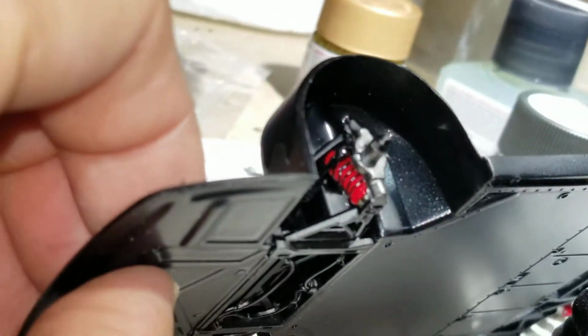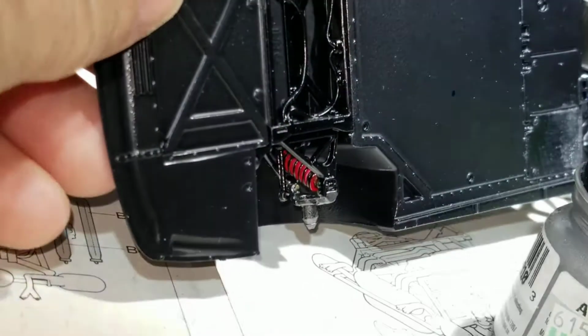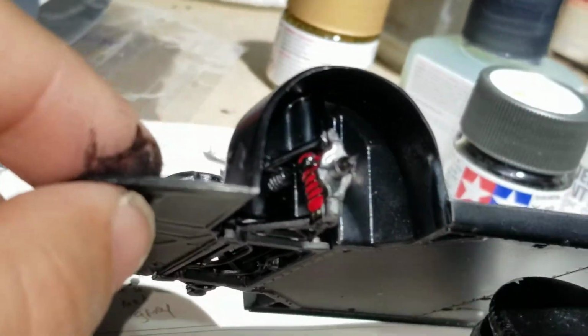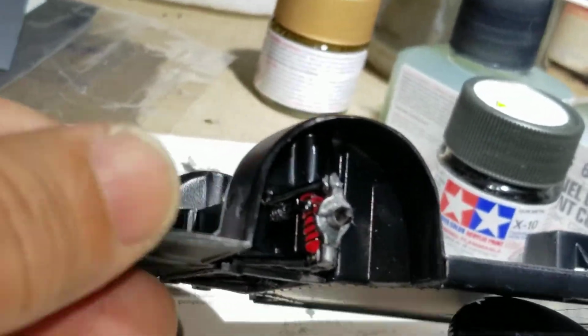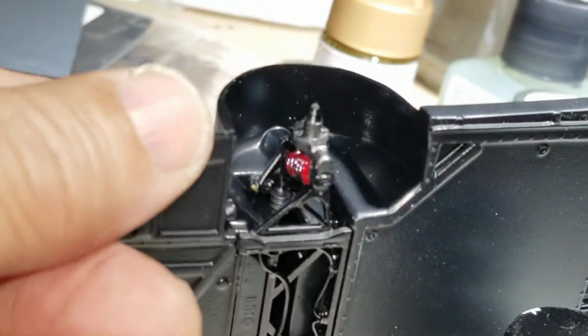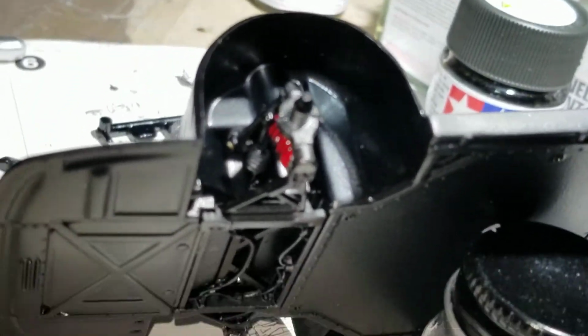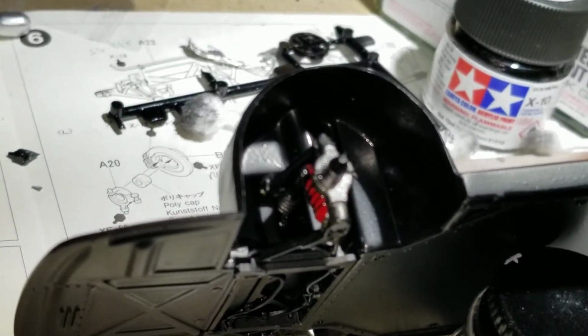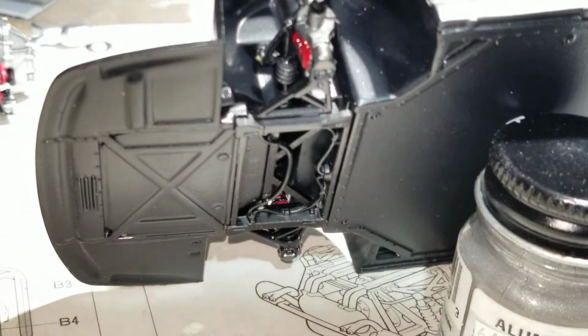It's got both upper and lower control arms. And again, instead of the shock mounting to the front subframe, it attaches to the chassis, which again is a great cause of misalignment issues. As you're trying to install the control arm, the shock onto the chassis and the subframe, it does make assembly a bit more difficult than it needs to be.